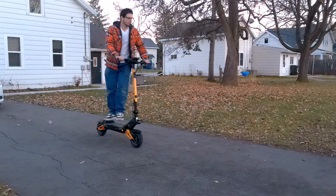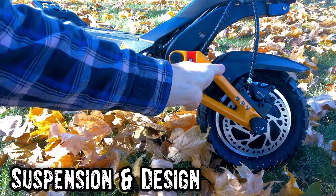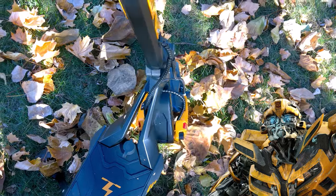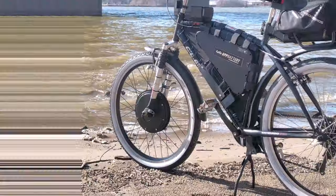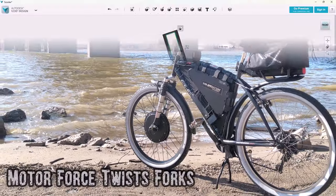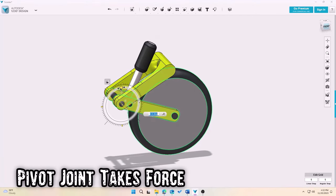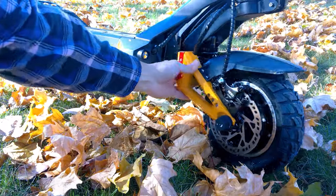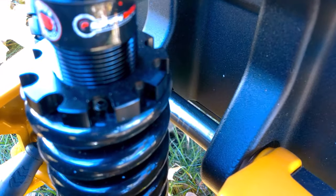I'm only barely able to bottom out the shocks by jumping on with my full weight. The suspension design looks a bit crazy, and the bulky front swingarm had me feeling like I was staring down at Bumblebee's head. Why the swingarm instead of forks? Front motors tend to cause forks to lock up under power; the swingarm places the motor's force on the pivot point instead, letting the shock do its job. The Gallop uses very sturdy oversized bearings and pivot axles which don't contribute to slop or any loss of steering precision.